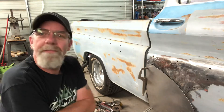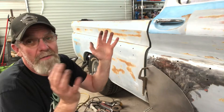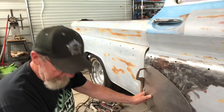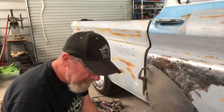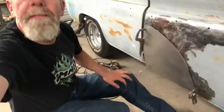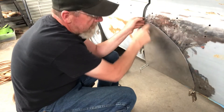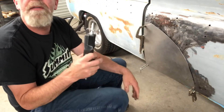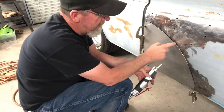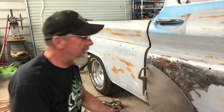Welcome back to the Ordinary Guy Garage, I'm Scott. This is part three of the door dent repair, or part two of the patch panel. The plan is: I trimmed right along here — that's a nice butt joint — and down on the bottom there's a nice butt joint too. The plan is to put a couple of tack welds, then take the body saw and cut a little bit, put a couple more tacks, cut a little bit more, on and on down the thing, taking my time and keeping everything cool.